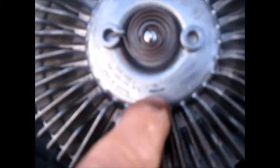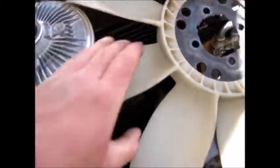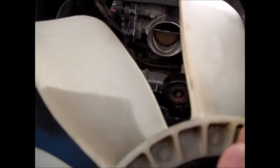There are four bolts on here. Remove those four bolts, place the fan on the new hub, and put it back together. When changing clutches, pay attention — some are clockwise rotation, some are counterclockwise. Even if the hub looks a little different, that doesn't matter. What you need to know is that it's the right rotation. You can see arrows on the clutch confirming the rotation is correct. Place the new clutch, put the fan on — these are aluminum, so be careful not to cross-thread them.